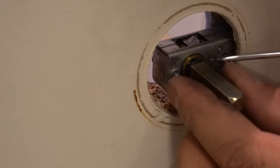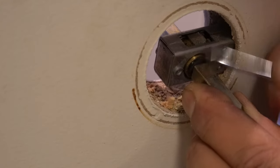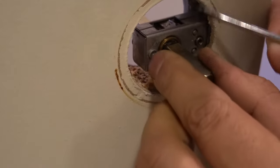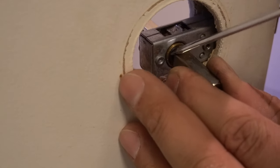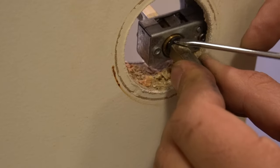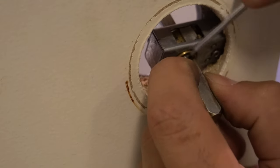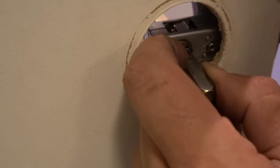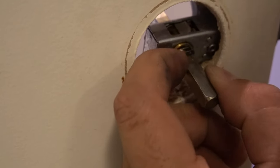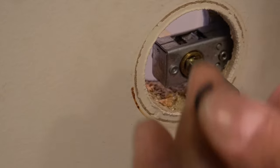To remove the o-ring we need a flat-head screwdriver. Be as careful as possible not to puncture it — if you do puncture it, it's not the end of the world, just simply replace the o-ring. I'm going to try to do this without blocking the camera, which means it might take a little bit longer. I'm just putting the flat-head screwdriver on the edge, lifting it up and stretching it just a bit until I can pull it over the shaft. Flick the other side over the corner and do the same thing down the bottom.